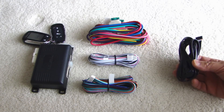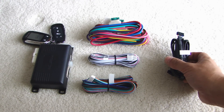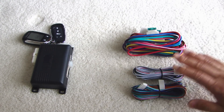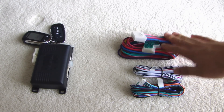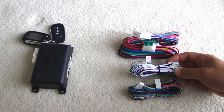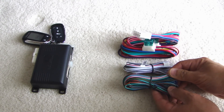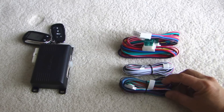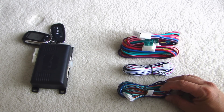This is for the antenna and all you have to do is run this from the alarm control module to the headliner where the antenna is going to be. These three remaining wiring harnesses will be used. This one is going to be the power, ignition, accessories, starter. Over here this is going to be your ground and your parking light output. And this one here with the smaller gauge wire — these are all going to be the channel output wiring. I will not be using all the wires here. Refer to the wiring diagram so you know which wires will be used and which ones will not be.